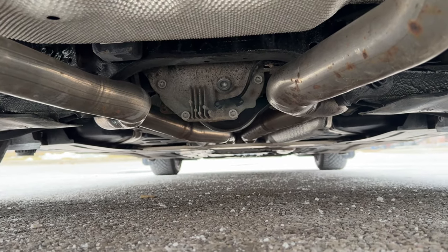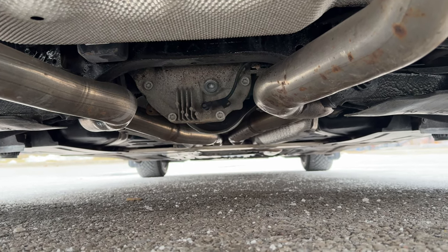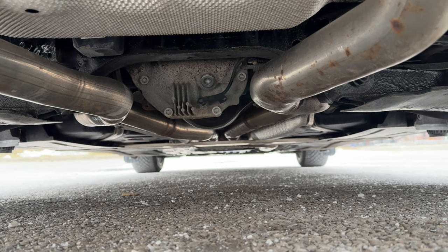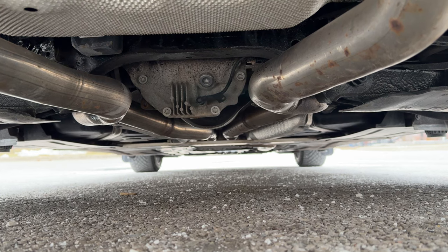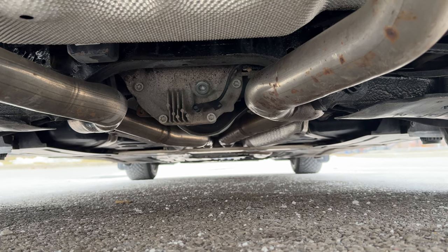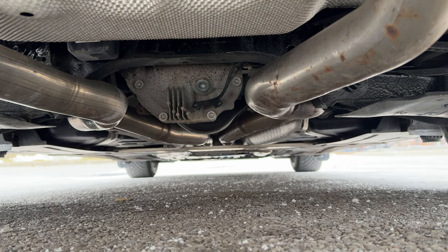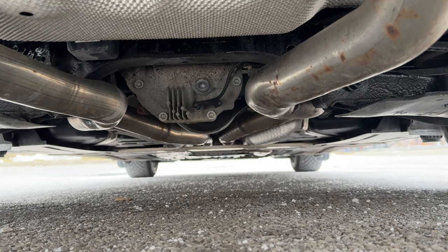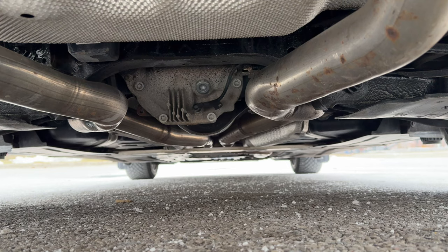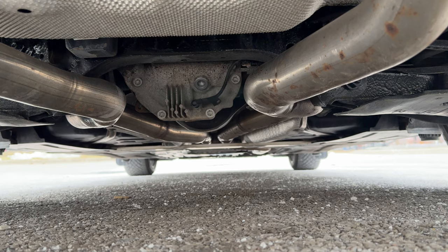We're going to step out of the car. The next common problem is the rear differential leaking. There is a vent on top of the differential to vent any excess fluid, and this is specifically going to happen when it reaches higher temperatures during track use. I changed my rear diff fluid recently — I also have a separate video on my channel going over how to change rear diff fluid on the BMW M340i and other models with a rear LSD, so check that out. In my case, I didn't see any sign of leaking before or after changing it. Just perform a routine checkup on the rear diff every now and then — the last thing you want is to run the rear differential dry.